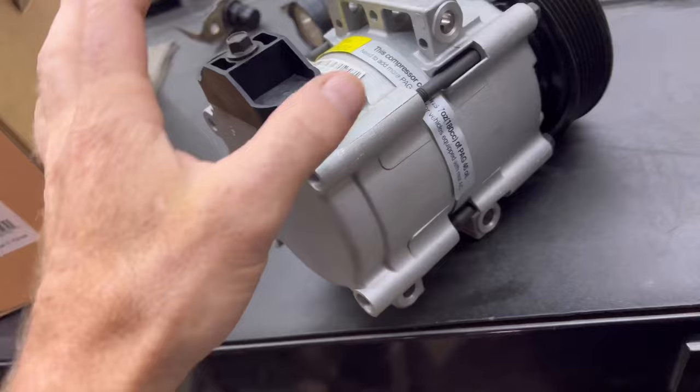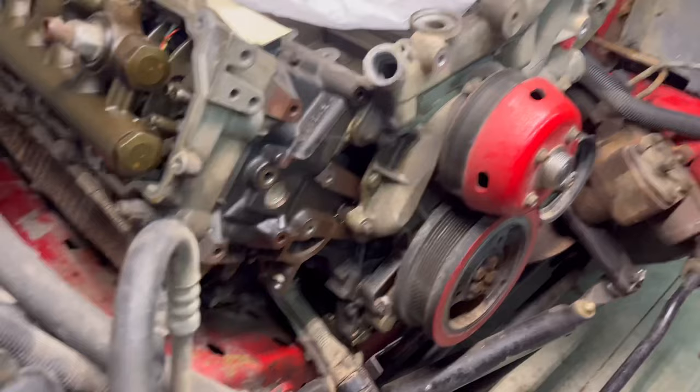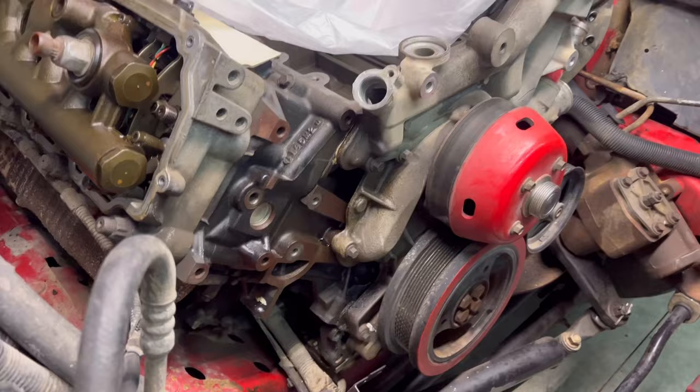We got the engine harness taped. It's got about a quarter of a million miles on it since we did it. So let's put cam and crank sensors on it, because those are about a 350,000-mile part in a perfect world. At 350,000 you're going to lose one, and then you might as well do them both. We've got 250,000 — let's get a reset right now.